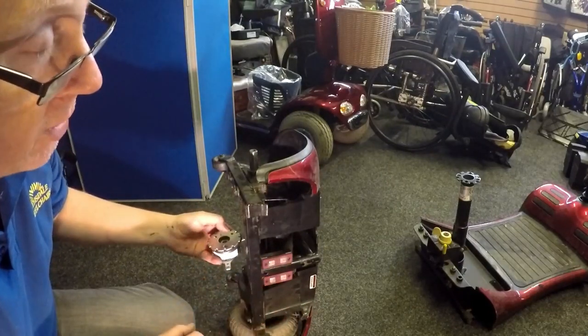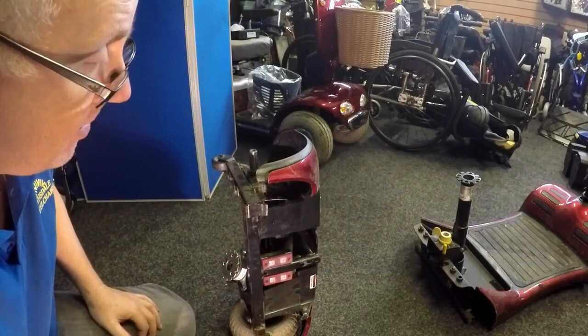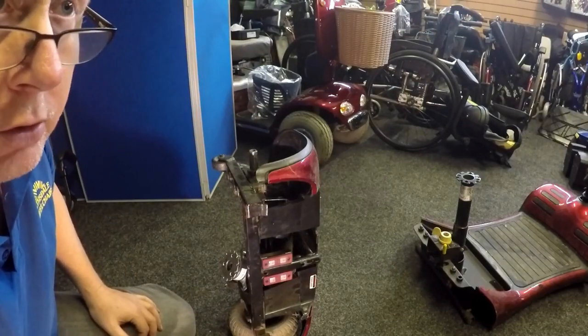I know when I press the wig-wag lever at the top that it's sending the signal to the electric brake but not to the motor. So what most likely is wrong is the main control box underneath the scooter floor panel, which to be honest isn't easy to get to. What I'm going to do is dismantle the side of the floor panel and have a look at the control box.